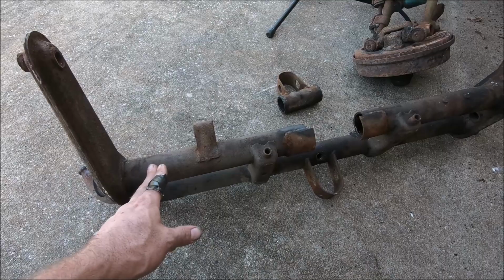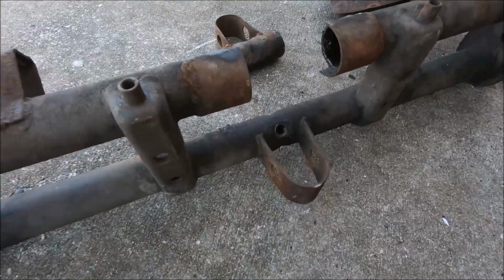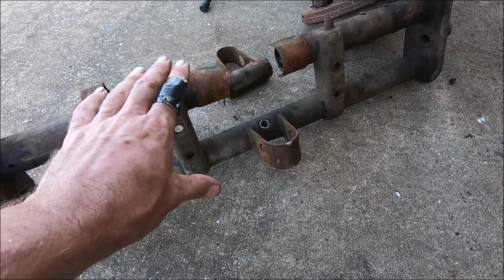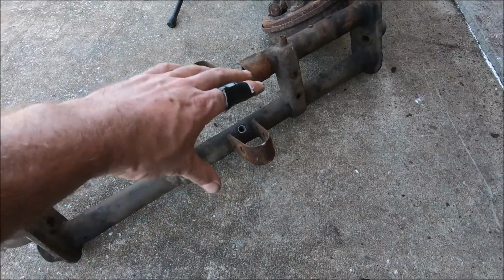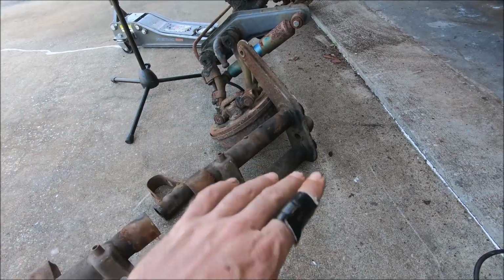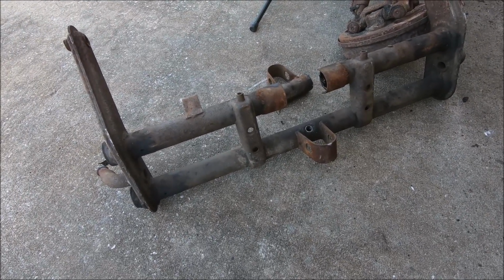So what we'll do is we'll go ahead and lop off the shock towers, cut this adjuster out of the way at the bottom, the old school style. And what we'll do is we'll use this, since this is a link pin beam, we'll use this to bolt to the car. Then we're going to take the frame head that we got off the Ghia, weld that to the front, and then we can then mount up that beam on the front of this. That's what's going to give us the extension. So step one, cut crap off.